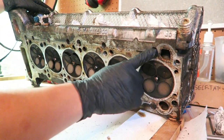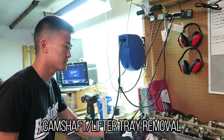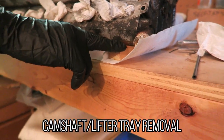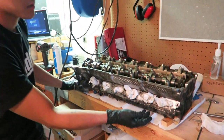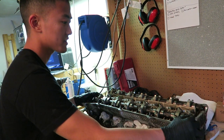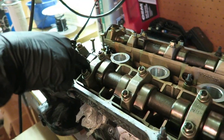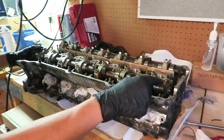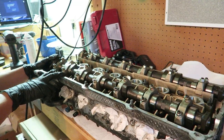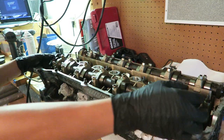There's not a lot of electrolysis around the coolant passages, which is good because coolant over time can eat away at the aluminum. Now that the head is off, I'll show how to take the cams off. I set the cylinder head on blocks of wood to keep the valves clear of the table. The general procedure is to rotate the cam so that two lobes on cylinder one are facing straight down, with the opposite end facing straight up, putting all pressure on one valve.